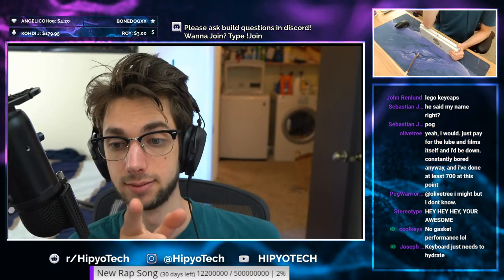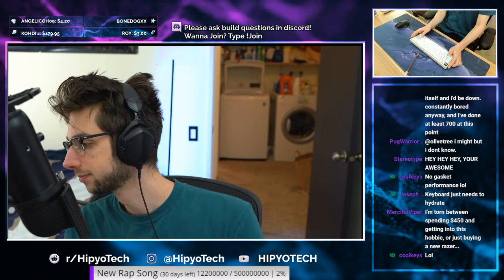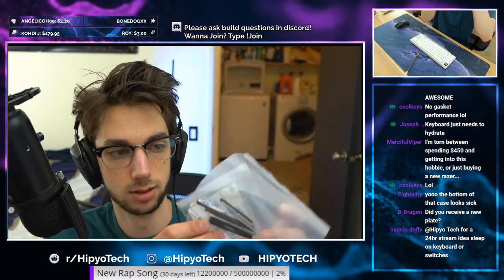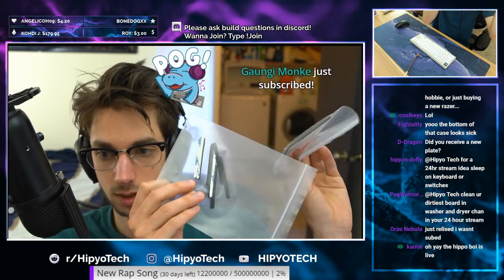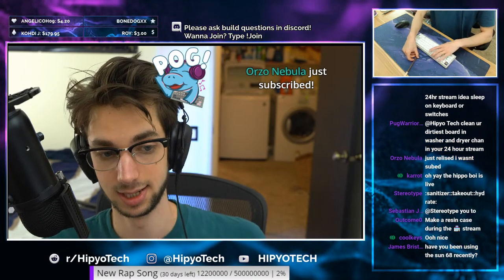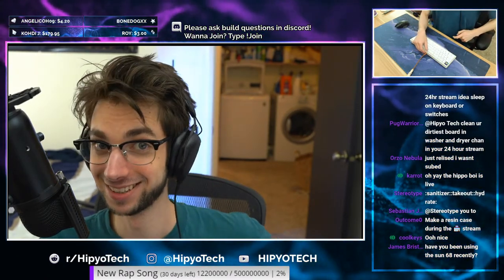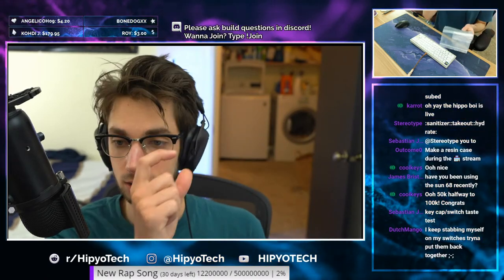Although, hey, I have something that I can show you guys later. Not this stream. But Ido Bao sent me a bunch of foam gaskets that they're going to be sending to all the ID80 Crystal people because they really messed up on this one. They ended up sending everyone gaskets that just didn't make contact. There's a reason my ID80 Crystal is not in the frame right now. That's because it has a keycap set on it that I cannot show you until later this week. Yeah, that's kind of exciting, right? So when I can show my keycaps that are on the ID80 Crystal, I will be taking it apart and replacing the gaskets with thicker foam gaskets so that there's actual contact.